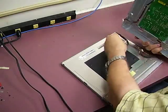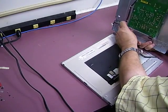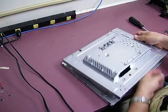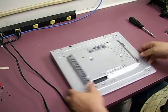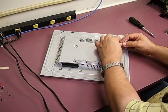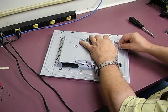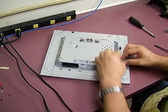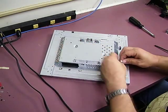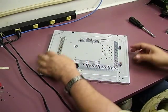We can flip the unit over. What we want to do is poke the backlight cables through the openings. Now when you go to plug the backlight cables in, it doesn't matter if the blue-black or pink-white is on the top — the voltage outputs are the same. You just have four connectors because there are four backlights, so you just plug those in.